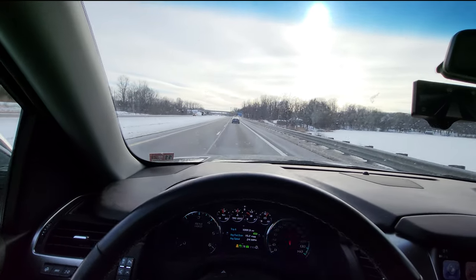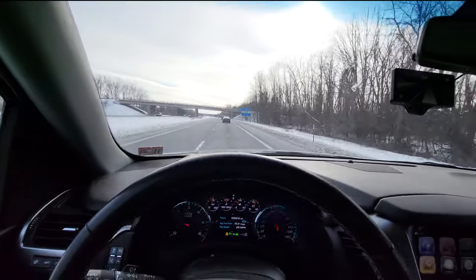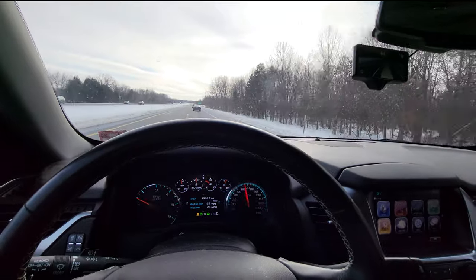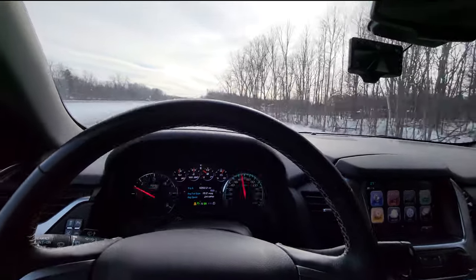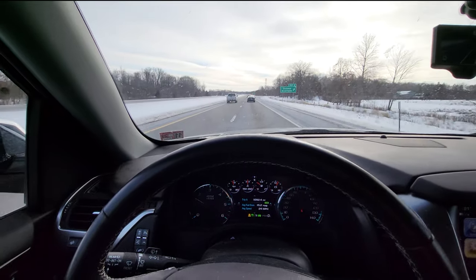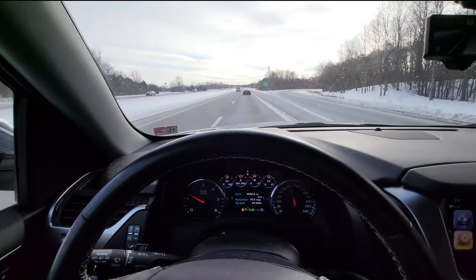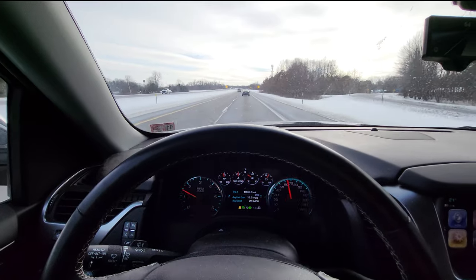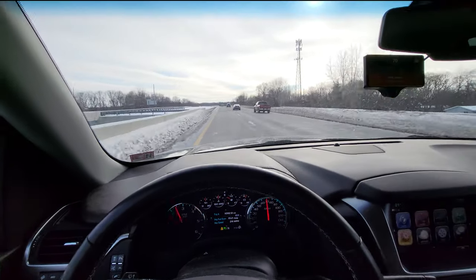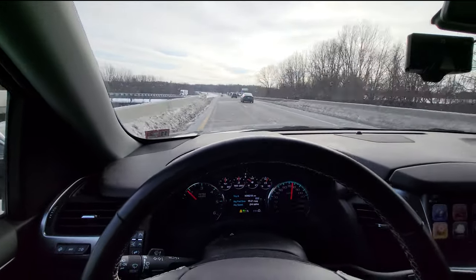The process of porting a vehicle is a lot like playing whack-a-mole. Generally, when you first attach this to a car that it's never been in, it's going to say the car is unrecognized. So you get it to recognize the car, and then it starts throwing all these errors. And so you start disabling those errors until you get it to work. But when it works, generally the actuators don't work quite the way you expect. I mentioned before about the whole putting one's life at risk. This is definitely a safety third kind of process, at least for me. I take the risks so that you don't have to.